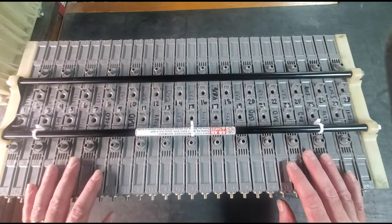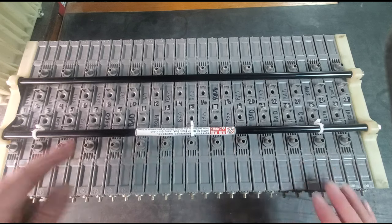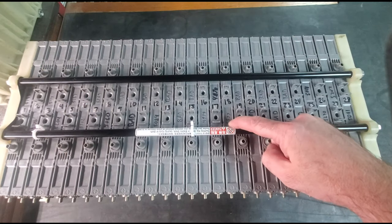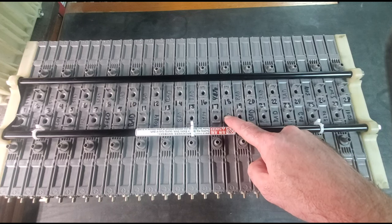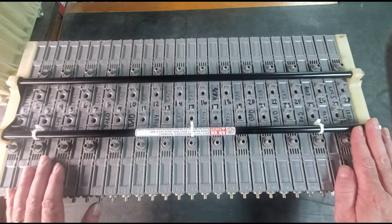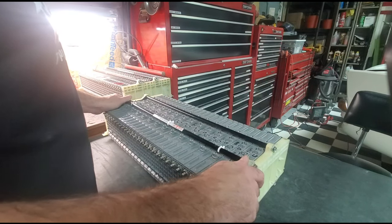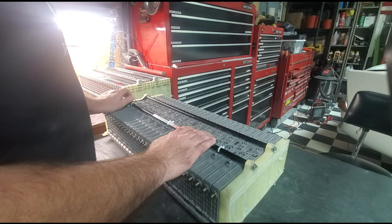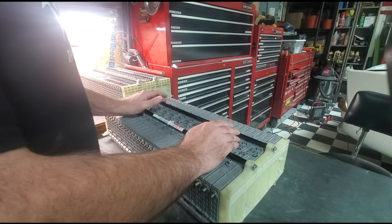I'm going to run the rest of these batteries and then show you the next step. I finished this process on the rest and ended up with 14 bad batteries overall. One came close but didn't quite pass — at 4,977 discharge, I ran it 20 times and still didn't get the results I wanted, so I'm replacing it too. This is the point in the process where you go ahead and buy your new batteries somewhere — either refurbished off eBay or similar. I have some spares that I was able to get enough of to replace the 14 bad ones in this pack.